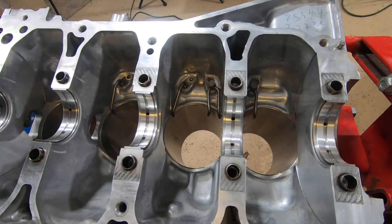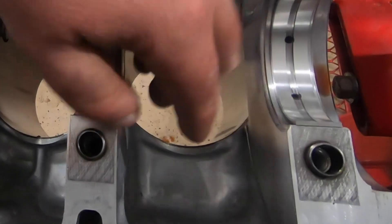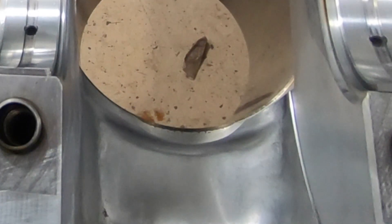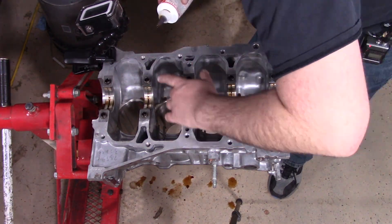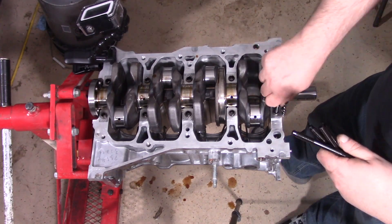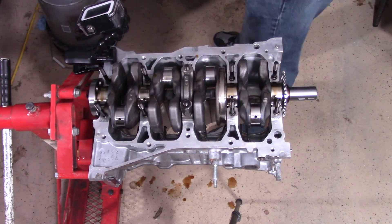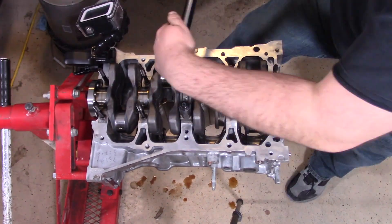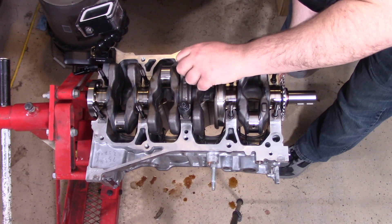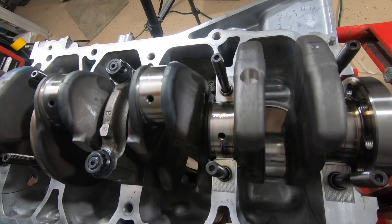Real quick before I forget — we gotta put the oil squirters in. If you're wondering why the inside ones have three squirters and the outside ones have two, it's a great question. I have no idea. These need to be seven foot pounds. By the way, you can actually see right down here that liner thickness looks like it's probably one and a half to two millimeters. Get some assembly lube on these bearings, spread it around, install the thrust washers — make sure you get oil on those — and drop the crank in. Get those main cap studs in. I can see an upgrade at some point for the center cap to have two thrusts to fight the pressure from the clutch release. Let's start applying the shmoo — three equal steps to 65 foot pounds. I don't think we've got the one and a half to two threads sticking out that ARP calls for, but they are definitely fully engaged, so I'm calling that good enough. Everything still spins nice and freely.